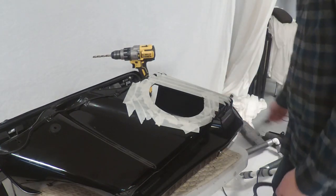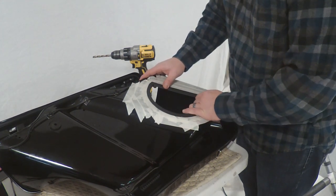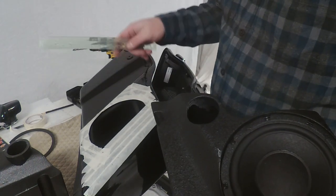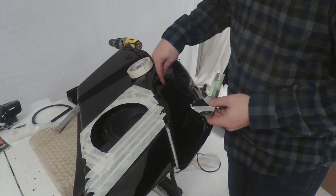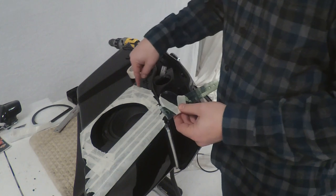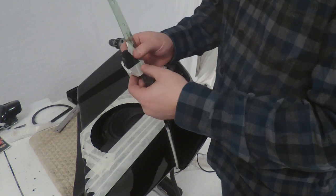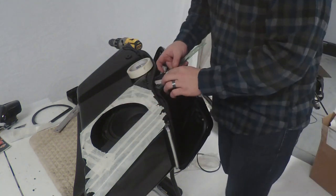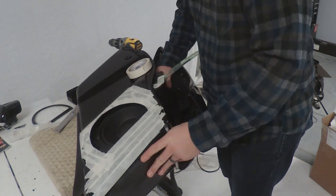Now that we've got this piece cut out, I'm going to go ahead and just check the ring — it is always better to cut a little too little than a little too much. Now we're going to be cutting the hole for this port using a two and three-eighths hole saw. The most difficult thing is blindly hitting the dead center of this hole. What we've done is just taped a ruler to here and set it at two inches on center, pushed this onto here, got our puck set and our speaker set.